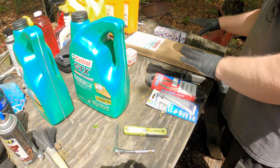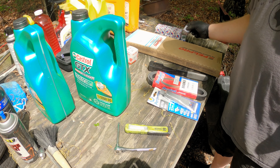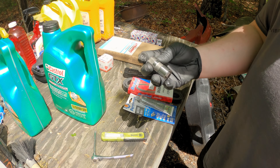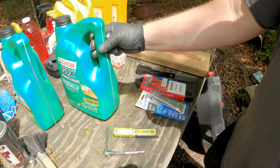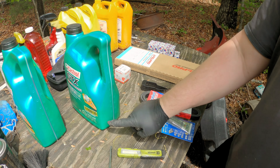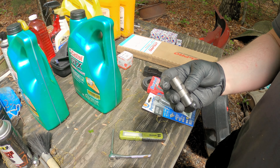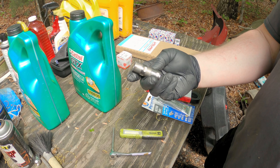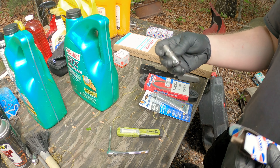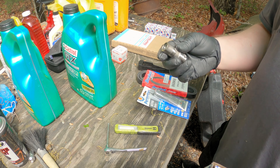Here we've got some of the parts - we'll go over more in depth what everything is later. But first thing we need to do: we've got these lifters and what I always do before installing lifters is soak them in oil. I've got this partially empty can of GTX here, I'm going to cut this open and dump all of these in there. While I'm taking it apart they can be soaking and filling up with oil so that when I put them in the engine hopefully they're not too dry - it just helps them get going faster.